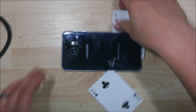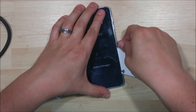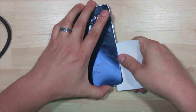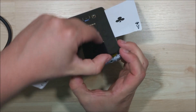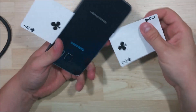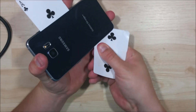This is my first time ever opening this particular phone, so I'm being a little more careful than I normally would, which is taking a little bit longer. Just work our way down the sides here. You can see that I'm pulling up on the back a little bit — that'll help us get the tape off. Right here in the middle is where it's being tricky on this right side.